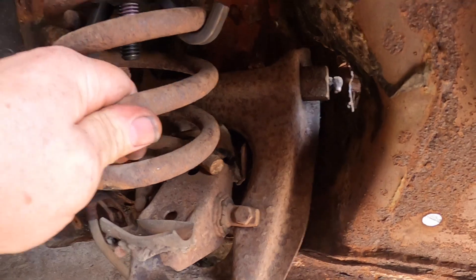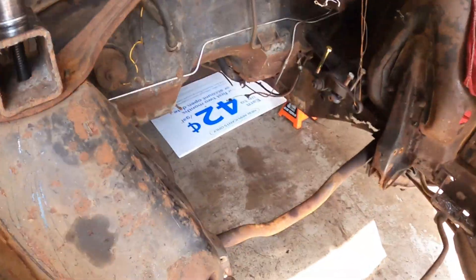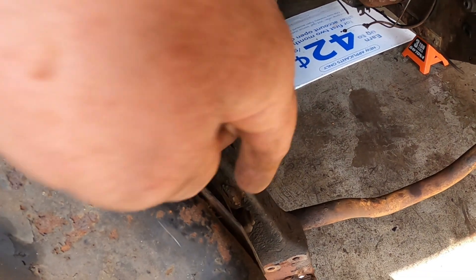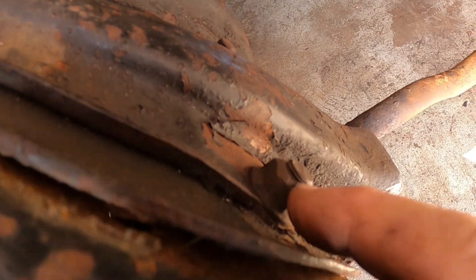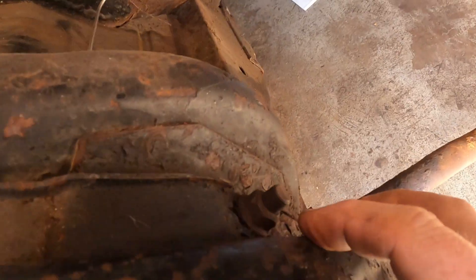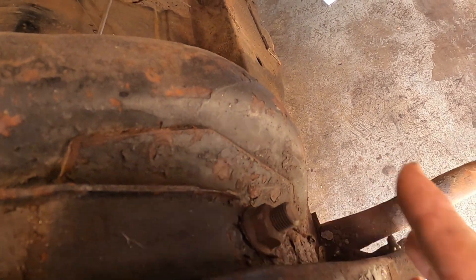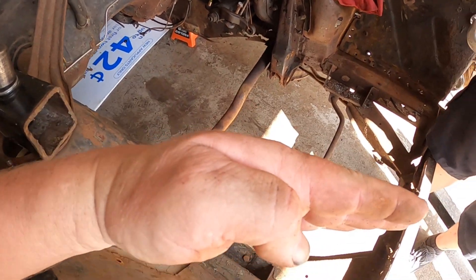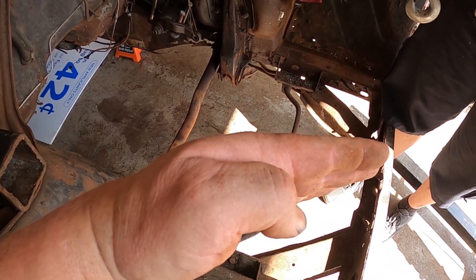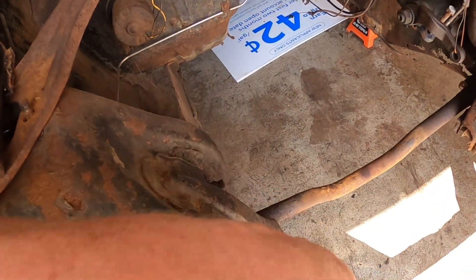The spring is off the seat and off the control arm. Now we need to get these two nuts out. As you can see with this nut here, there's only about two threads showing, and on this one there's like ten threads showing — so the control arm is actually sitting in the car cocked to give it some caster or camber. Go get a socket that fits this and the electric impact gun.